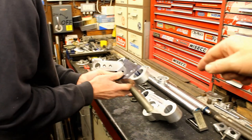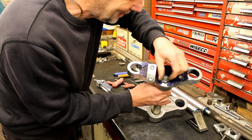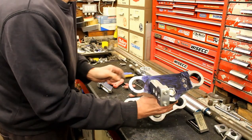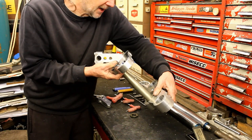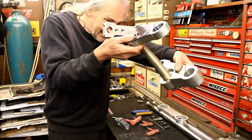The top nut was a chrome dome but someone had hit it, so Jeff machined it off. Because he's broken through the chrome it might need a touch, but since it's not going out in the rain it's not a worry - and it looks quite high-tech. Standing the assembly up, the angle is going to be 42-43 degrees. Jeff has machined the risers at 45 degrees so they'll kick up a couple of degrees - almost horizontal but not quite.